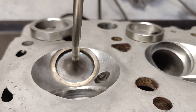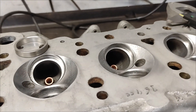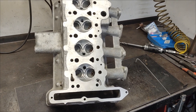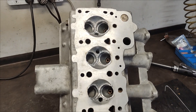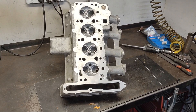I'm going to weld around all of those in the head so we can start fresh again. I've finished welding around all the insert holes, so now it's just a matter of giving them a bit of a peen — that just helps harden the alloy. Then it'll be ready for machining out to fit the new inserts.